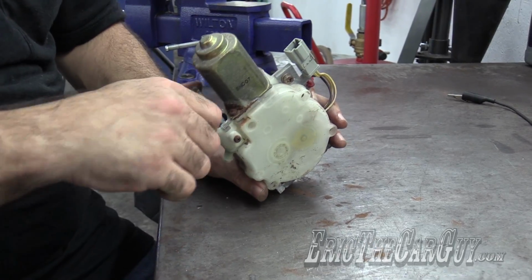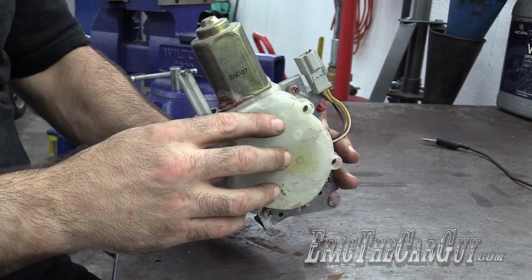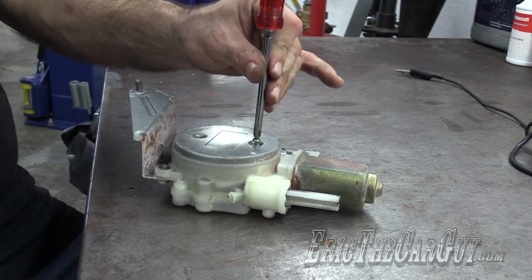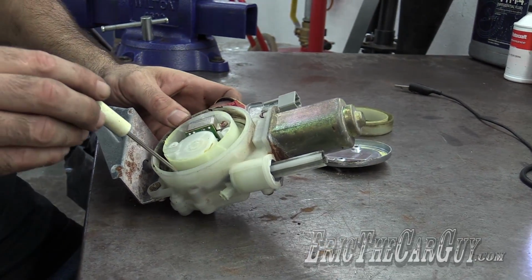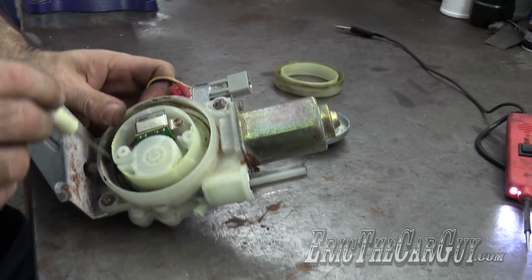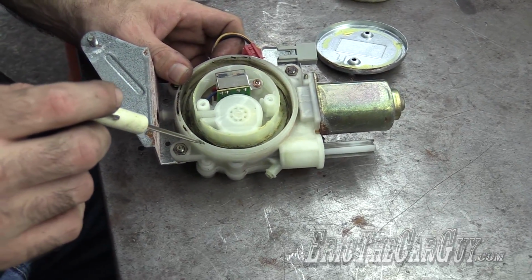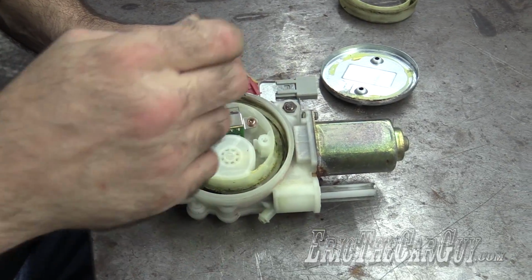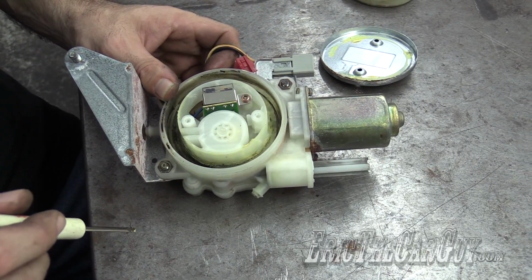and then another plastic tube down inside. Now this plastic tube has an O-ring, and I'm trying to figure out how I can show that to you. And that O-ring is kind of important, because the O-ring helps guide things. There's a giant gear behind here that basically connects with those teeth on that antenna mast assembly that I showed you. And then it just sort of coils around in here. Here's a sensor to say, okay, the motor's had enough, stop moving.